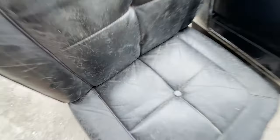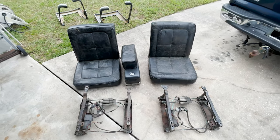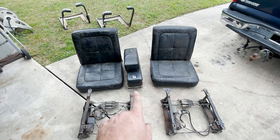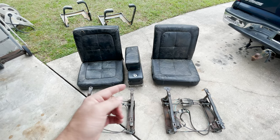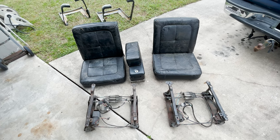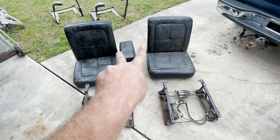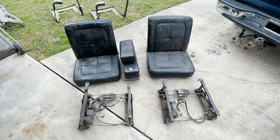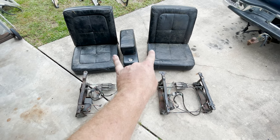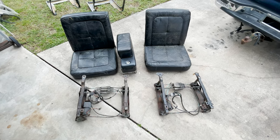This one's got a little bit of almost gross mold, maybe. Wash my hands good. But yeah, so there you have it — you've got the two backs, the two seats, the center console with the plug. One thing I didn't take out is it did come with the bracket as well — there's a bracket that goes underneath that mounts to the floor. The other thing it came with is the ductwork. The AC does not blow into the back even if you have the ductwork that goes around — that's only for the heater. The ductwork that plugs in under the dash brings that heat all the way back under the floor for the rear passengers, but not the AC. It came with the metal piece to mount the console and everything you see here.